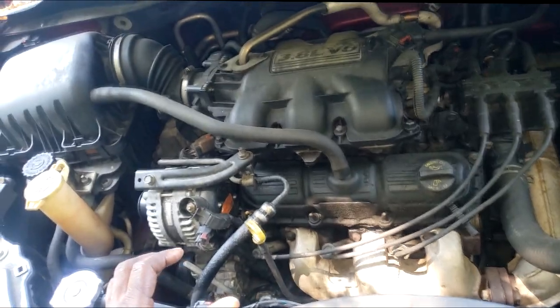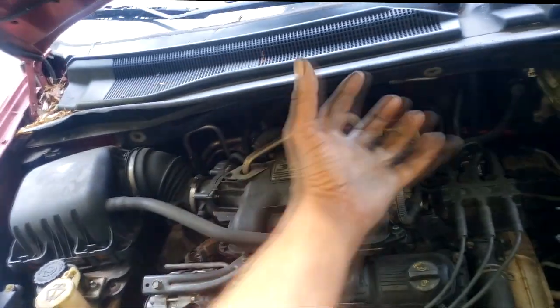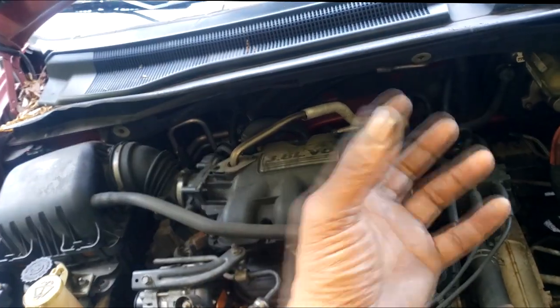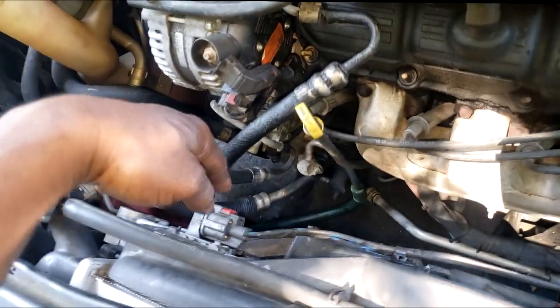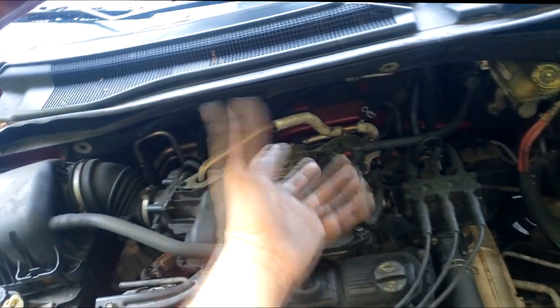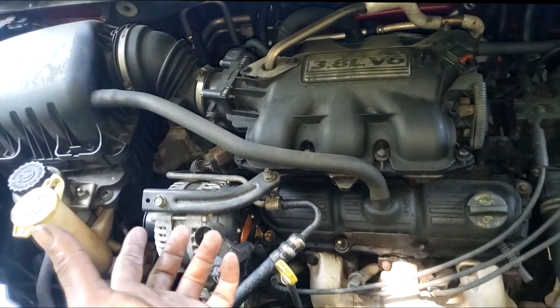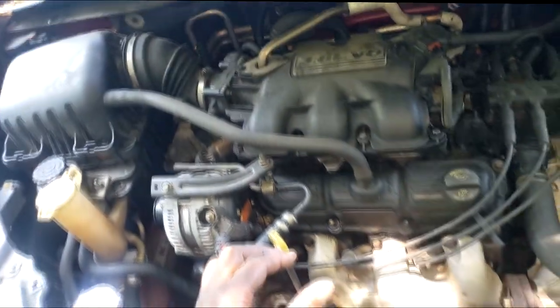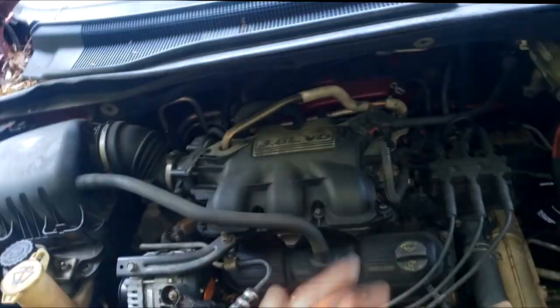All right? So now keep in mind how leaks work, guys. The leaks are typically drawn to the weakest link. If the hose is the weakest link, I'm gonna get all my leak out of there. There still may be other leaks. That's why AC system repairs are basically done in steps. What I mean by that is I have to fix this obvious leak just to proceed.